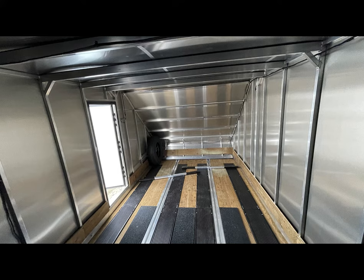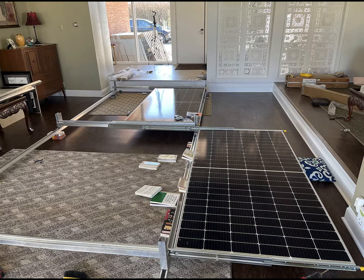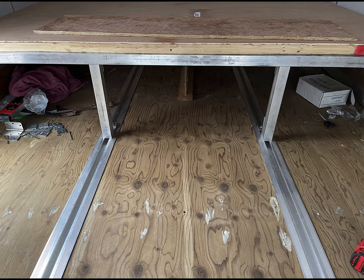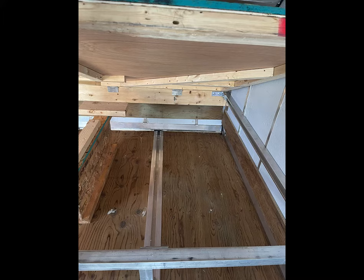When I got the trailer, it was just bare on the inside. It's a toy hauler meant for sleds. I started building the solar panel rack in my living room and was insulating the inside of the trailer with one-inch foam from Lowe's. I built the structure for the solar panels out of aluminum unistrut, and then I used the extra to build a bed in the nose area. It tied in nicely with the tracks for the D-ring tie downs.